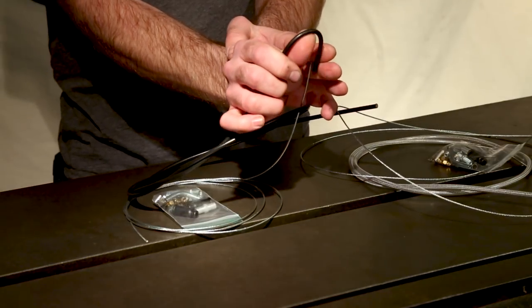The outer housing is comprised of a helically wound square-section steel, and that allows it to be flexible — you can bend it around and surprisingly the bend radius is pretty small. Around the outside is a black coating that protects the paint and everything else on your bike, gives a generally appealing appearance, and prevents rust and corrosion. The stainless braid version is just a little bit dressed up — an aesthetic choice. The core structure of the housing is exactly the same, and both have a Teflon inner liner that makes the cable very smooth and slippery as it goes through the outer housing.